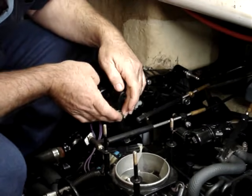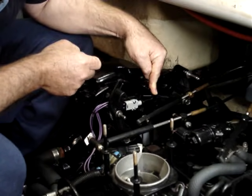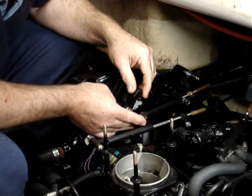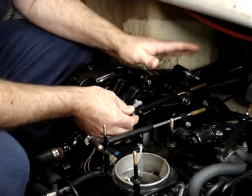Got to be a little bit careful — don't go too far. Because if you activate the shift cutout switch, then obviously your engine's going to stall. So we start with it in the lowest position, place it there, and that's it.